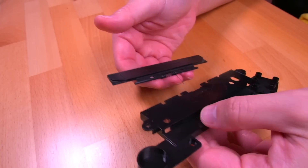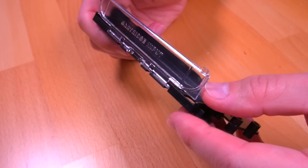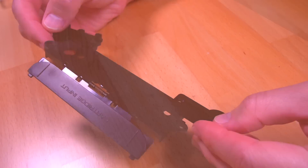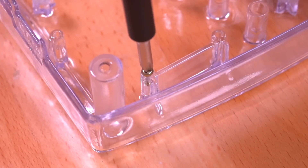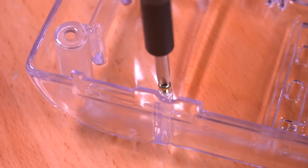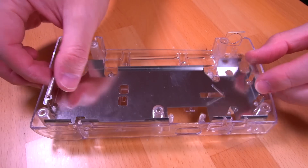The first thing I was going to replace with a 3D printed part was the cartridge flap cover. Unfortunately, the part that allows it to pivot, open, and close is too thick, causing it to get stuck and not return to the closed position. So I'm just going to use the original one instead since it works perfectly fine and is in good condition. My guess is that the varnish coating on the flap made it just a bit thicker than it should be, causing the issue. Now let's start to assemble everything back together into the new shells. The first thing we want to do is pre-tap all the screw posts — carefully fasten all the screws in and out of the screw posts to create threads. By doing this carefully before assembly, we ensure that we do not crack or break the screw posts by accident. This is a crucial step, so don't skip it.